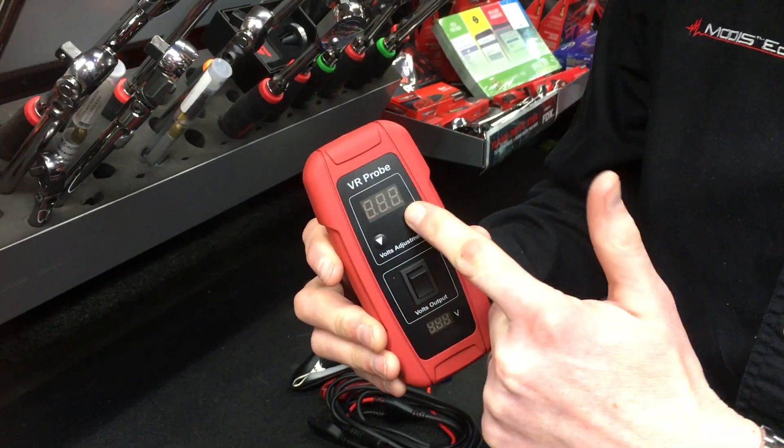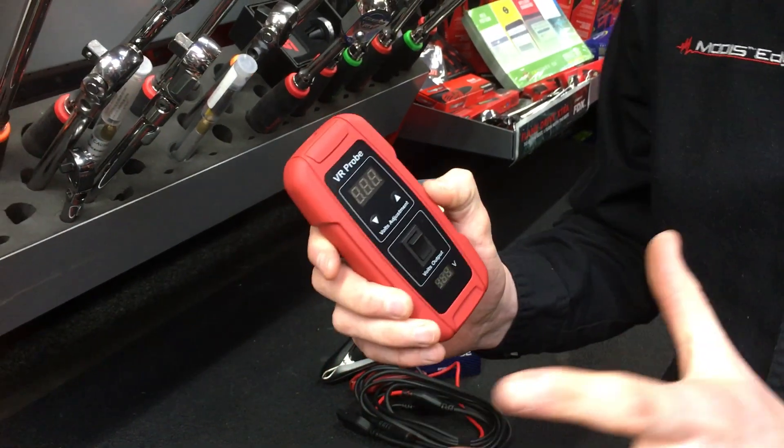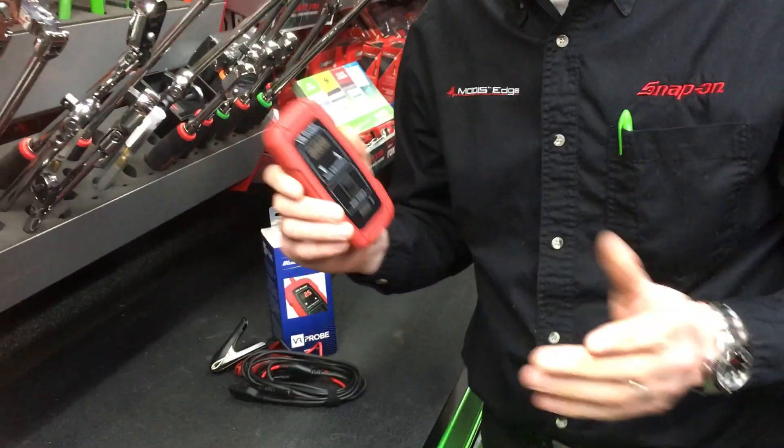When you press the button, the output voltage shown on the screen is sent out through the probe. What a fantastic idea! If you've got a component which is failing to send a signal back to the ECU, you can simulate that the component is working correctly, or bypass a component and send the desired signal straight back to the ECU. So if it's 5 volts you're looking at, set it to 5 volts, send it down the wire you need, and the ECU thinks everything's fine and the vehicle starts to operate correctly. You can eliminate faulty products, or if you've got a faulty wire, go straight to the back of the ECU on pin 15 or whatever you require, put the desired voltage in, and the fault code should disappear. You should be able to use the vehicle as normal, and this will point you directly to what is wrong with the vehicle and which component has failed.